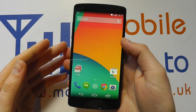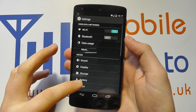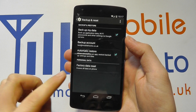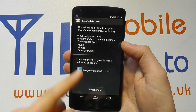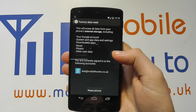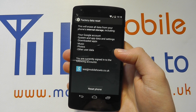With the device switched on, you need to access the settings. Scroll down from the top, click the panel, click Settings, and scroll through the list until you get to Backup and Reset. At the bottom of this menu you'll see Factory Data Reset — tap on that. It will then explain exactly what will happen: it will restore all of the internal storage back to factory default settings and wipe anything that we have on here.